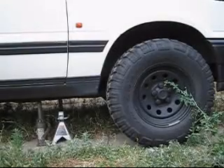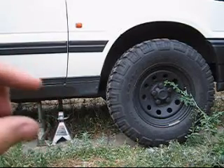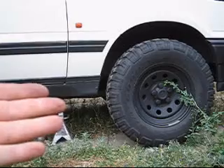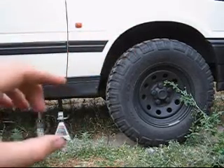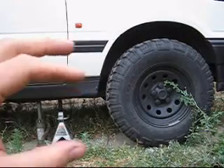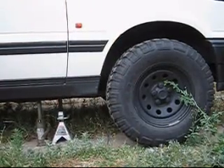We're now ready to air the system back up. You've checked the airline, inspected it, and put it back into the top of the air spring — now the car is on the jacks. It's important not to lower it down just yet. I'm going to start the vehicle, tell the EAS to go to the maximum ride height for maybe five to ten seconds, putting a little air pressure in this side. Then shut the engine off, come back out, and lower it down. You do not want to lower it when it's completely empty — the rubber will get folded under in a very unhealthy way and it will damage the air spring.